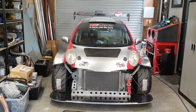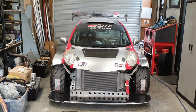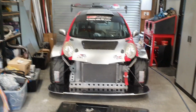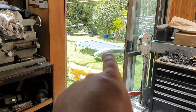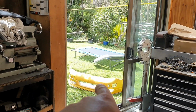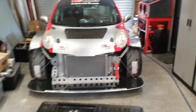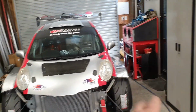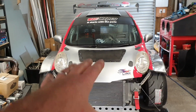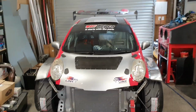Yeah, the front fell off, as those Australian comedians say. It is outside of the environment, over there, not the yellow one. That does look quite funny sitting in front of the marsh. It's over there drying, some primer and stuff going on there. Reason being, as you know, new tyres, wider, change the shape of the front guards and all that sort of carry on to get the right ride height, and we're changing the shape of the bumper so it's better.